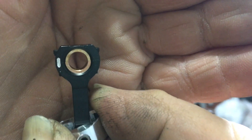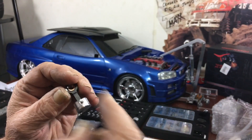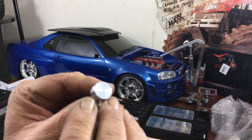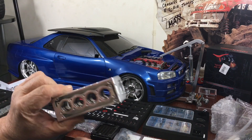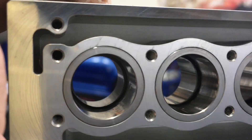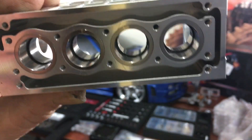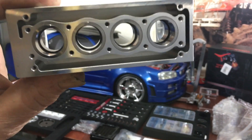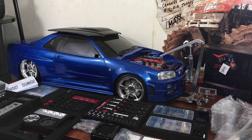Those two halves must mate back up when you put it together. I put all mine facing forward. Use some lube, and be careful when you put the ring on — put a little grease on it and slide it around so it snaps in. There's a ring gap where the ring is gapped. Each and every ring is machined for each and every cylinder, so do one cylinder at a time and don't mix them up — it's important for the longevity of the engine.